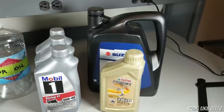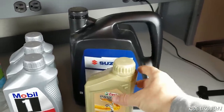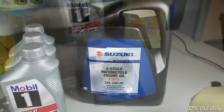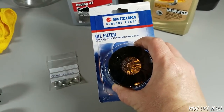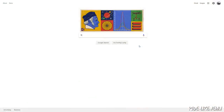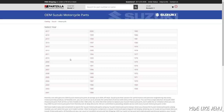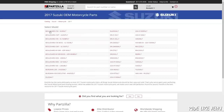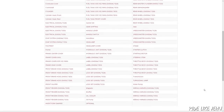This is also good. If you're doing the 600 mile service for the SV650, you may want to use Suzuki brand oil and keep the receipt for that. You're going to need an oil filter — I just use the Suzuki brand oil filter. Finding OEM Suzuki motorcycle parts online is pretty straightforward. Websites like Bike Bandit or Partzilla.com give you access to the Suzuki parts catalog, so you just have to navigate through that to find the part you're looking for on your bike. You'll find the oil filter under the oil cooler group.